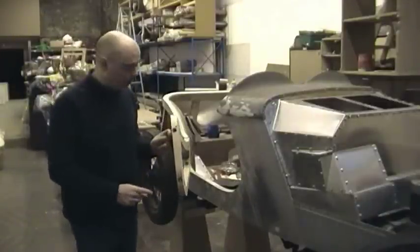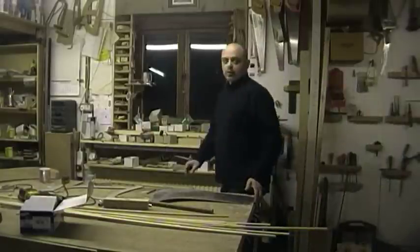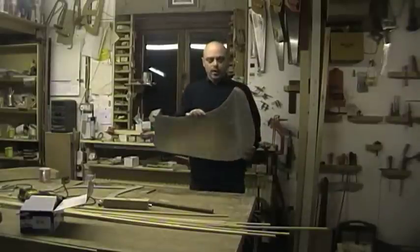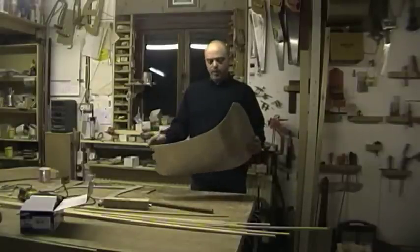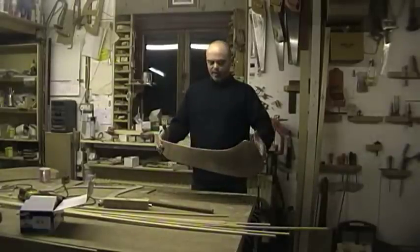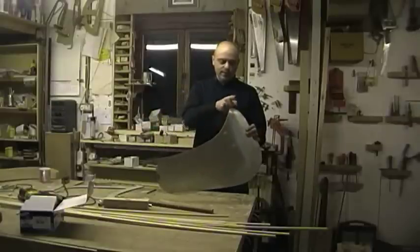This is bolted but not yet doweled, so I'm just doing the final adjustment. Stage one was to cut an aluminium door skin — this was done basically just with a hardboard template on the car, then transmitted onto the aluminium and jigsawed out, very very simple. I had to make about three templates before I was happy with the shape. This shape had to follow the back of the car round and then up to the scuttle.